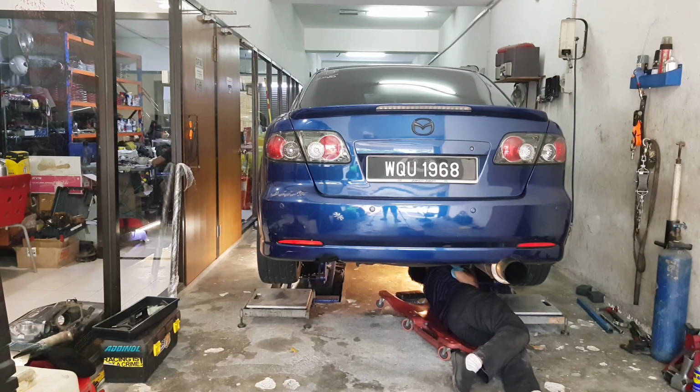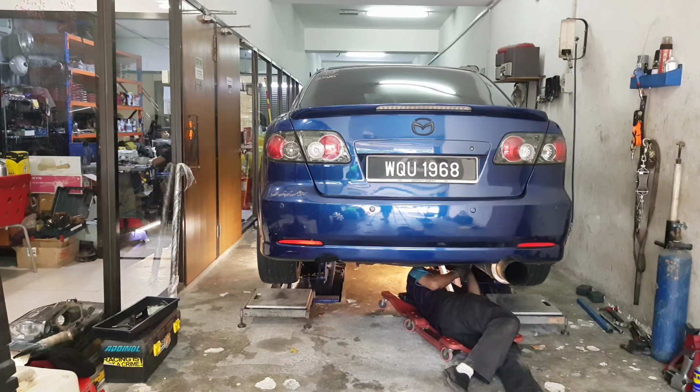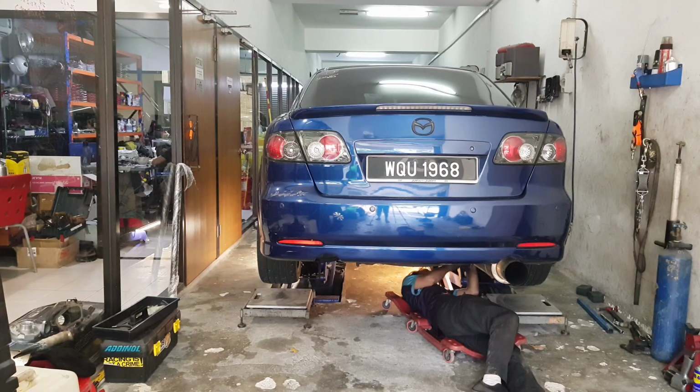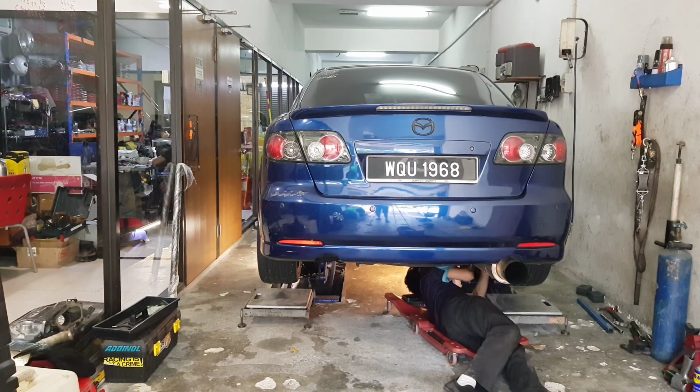There is nothing much I can do about my camber, and there is nothing that can be done about my caster as well. I already have caster bushes that allow me to track the car in a straight line perfectly, and camber adjustment is probably height dependent because I have a multi-link double wishbone suspension. If I am to enable camber adjustability, I will probably need camber arms at the back, and of course upper adjustable arms in front. So I will take a hyperlapse video on them setting up the car, putting up the poles and the strings and everything in a little while.